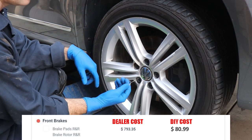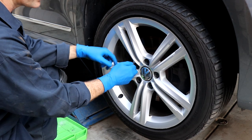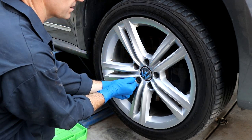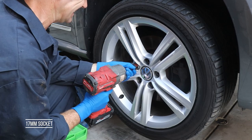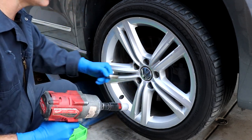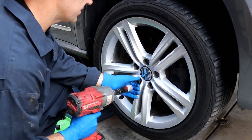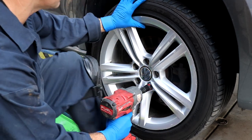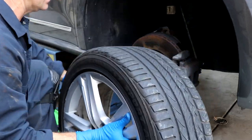All the common late-model VWs have caps, so you either use a hook tool or little tweezers — put it in and pull it out. This exposes the lug nuts so you can get your 17 millimeter socket on there. Feels like the dealer got a little crazy with the impact after he took the wheels off to send me a video telling me how bad my brakes are.